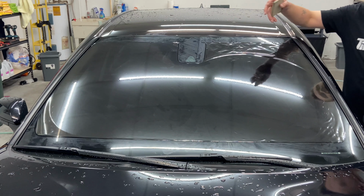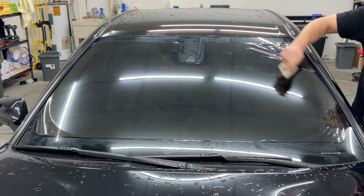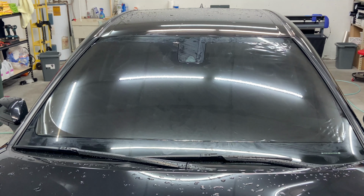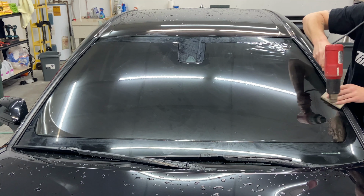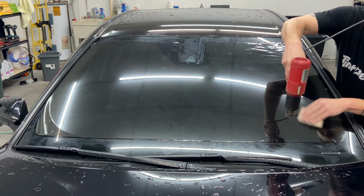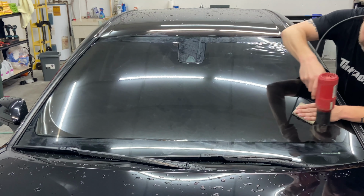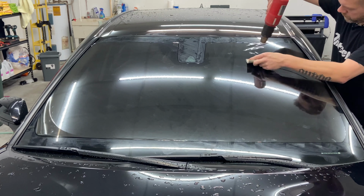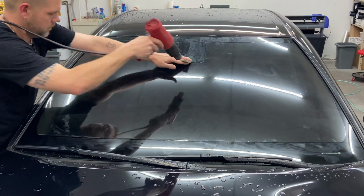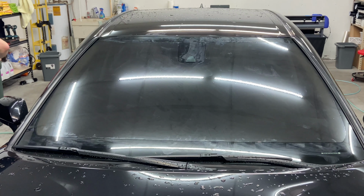Windshield's cut out, glass aid is off, so now we're going to polish our edges again, just like we would on a rear glass. Really tighten up the corners, and obviously the edges where the glass aid was. Tighten those up. It's ready to install.